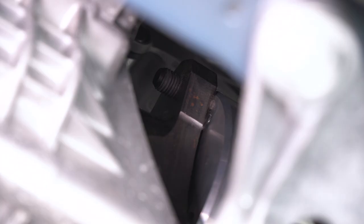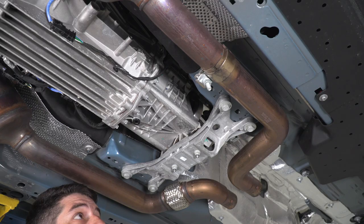So the three bolts that you just installed in the flange for the drive shaft are actually extending out past the back of the flange for the transmission. That's on purpose. They provide you with a lock washer and a nut that needs to be installed on the back for extra security. You're going to need a 19 millimeter wrench to tighten down that nut, and you'll hold the bolt tight with the 10 millimeter Allen that you used in the previous step.